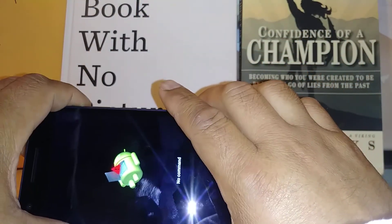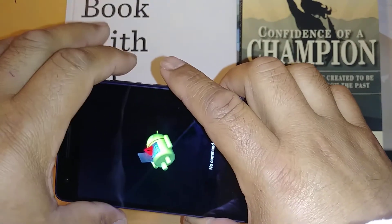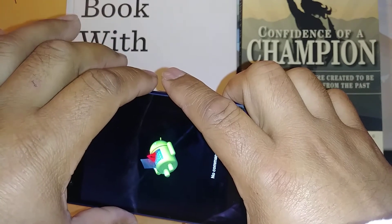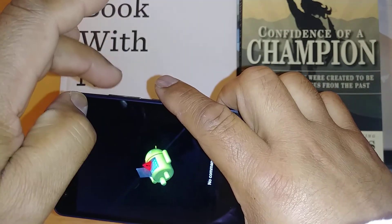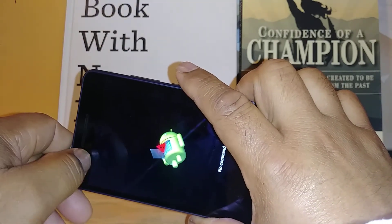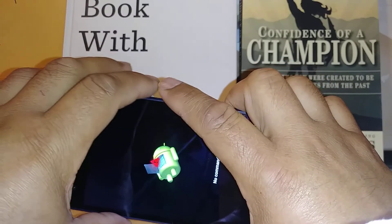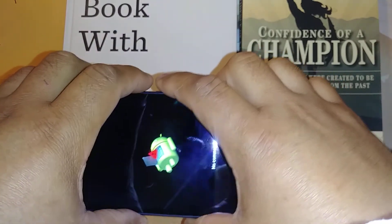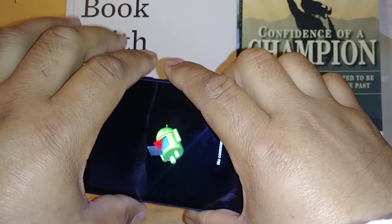With the robot on the screen, we're going to press Volume Down and the Power key at the same time. This finger has to be ready to press Volume Up. You need to press Volume Up properly, and as soon as a menu with blue letters appears on the screen, release Volume Down and the Power key immediately. Ready — Volume Down and Power key, then get ready on Volume Up after.